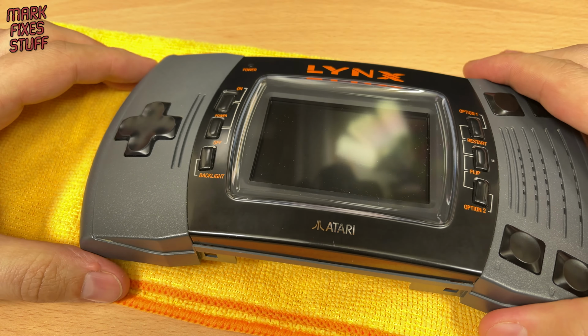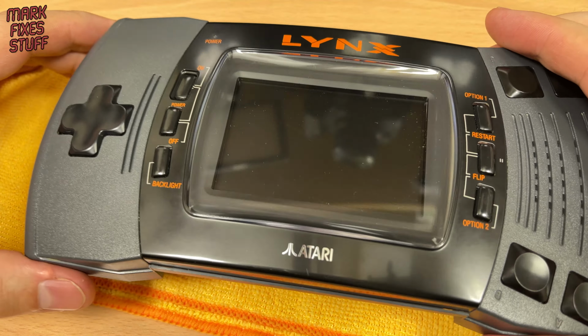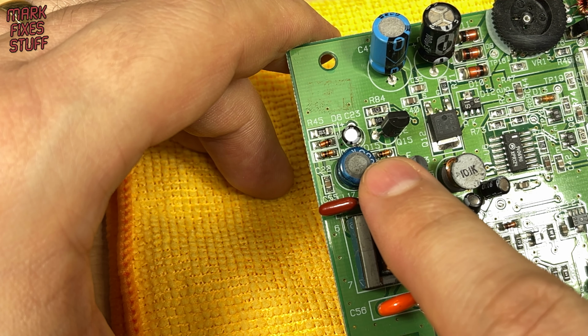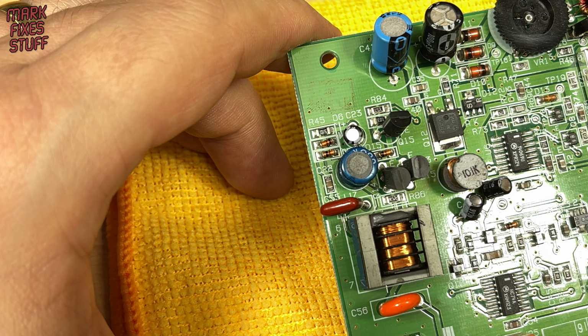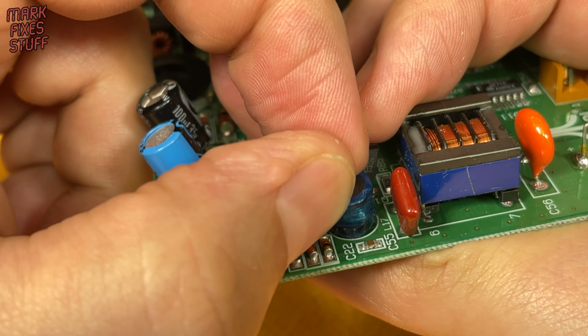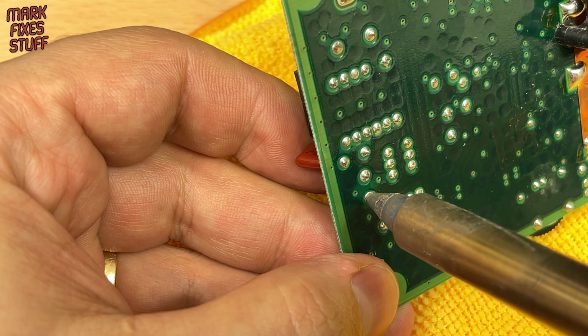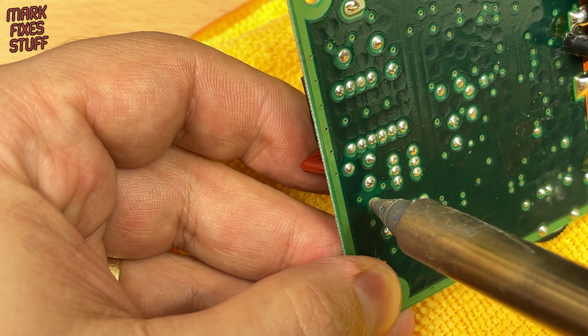With the LCD panel in place, we need to look at the main board next. This inductor needs to be removed from the board. BennVenn says you can just rock the coil until the legs snap. I'm going to desolder mine because I have the equipment here.